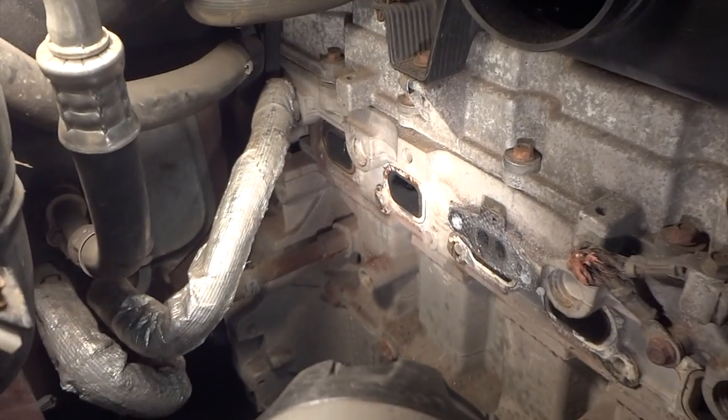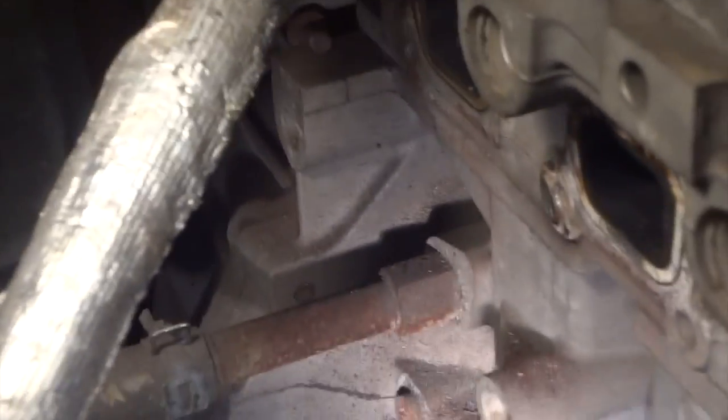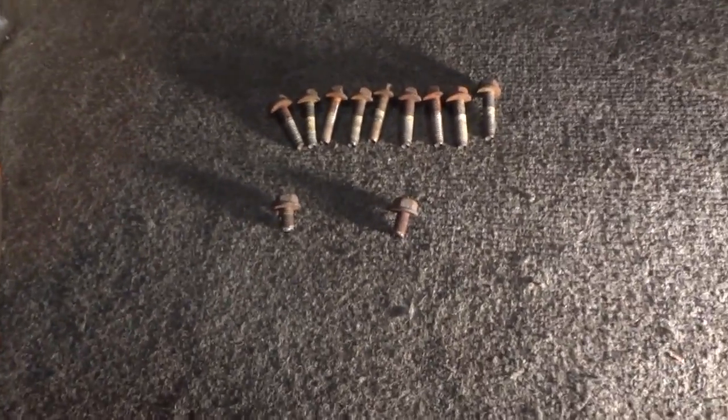Let's go a little closer here and see where the damage is. It looks like this one here broke off right here, and one back here in the back. There's the other bolt that broke off that I didn't see — it's back here sitting. I'll get it if I can — come on, there it is. So this one was already broke off before I even got to it. This is the one that I broke off. So there's 11 in total. The two there that broke off — I can get in there and drill them out, tap them, and probably get the rest of it out. It shouldn't be too big of a deal. I'm happy about this.